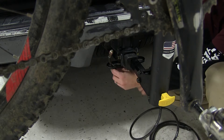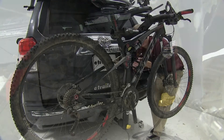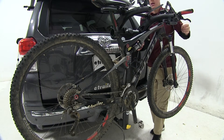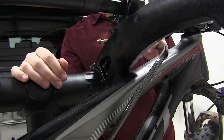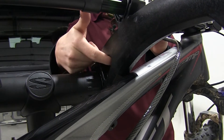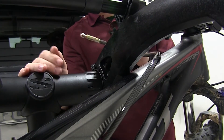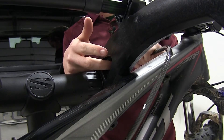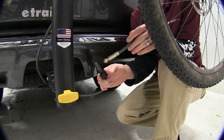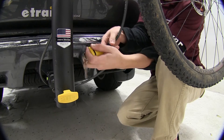We'll take one end of the cable and go around one of the loops on the hitch and pull the cable up. We'll then take the end of the cable and go through the bike frame and back around. Depending on your bike rack, you may be able to loop the cable through a hole or another attachment point to also secure the bike rack to the vehicle. For today's application, the hole isn't big enough, so we're just going to bring the cable back down to the rear of the car and insert the gold pin into the loop at the end of the cable and secure it with the lock.